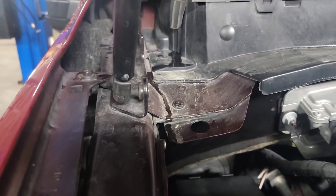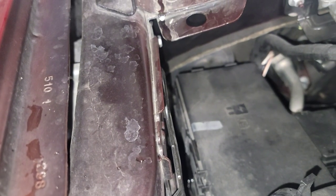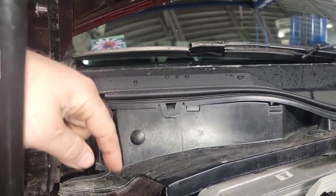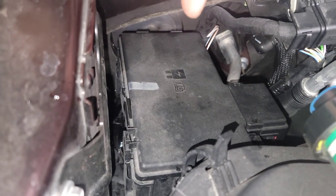See that water? It runs off the windshield up here — it's been raining. You see where it runs right down next to that fuse box? Sometimes if it's bad enough, that water will run off of here and it will flood this area right here, get on that box, saturate it, and you'll get these fuse boxes that fill up with water.